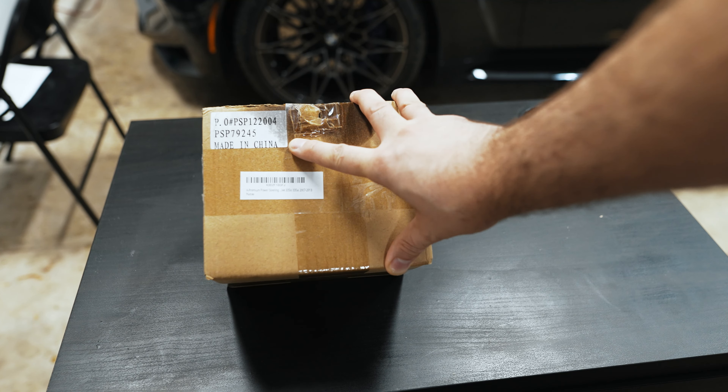Here's a look at the pump itself. Because my car has active steering, it has this electrical connector that would be different from a standard pump. But if this were to let me down, worst case scenario I'm back at square one with heavy steering and I can get my car home. I'm spending $130 instead of $900, so the trade-off is worth it.